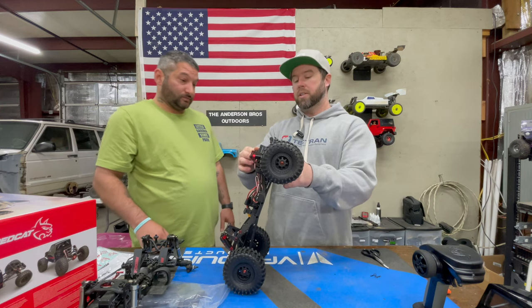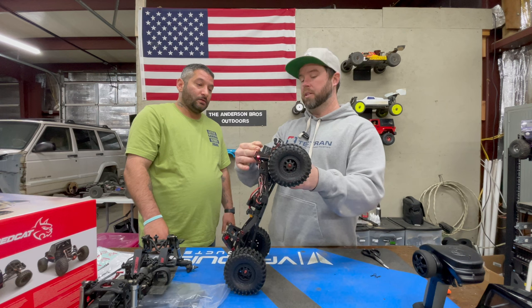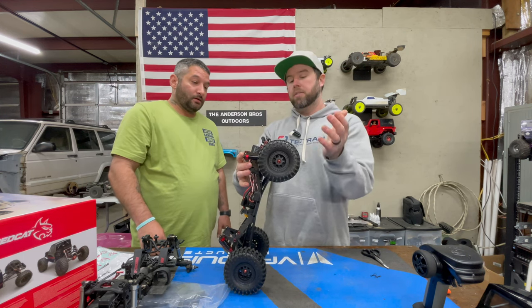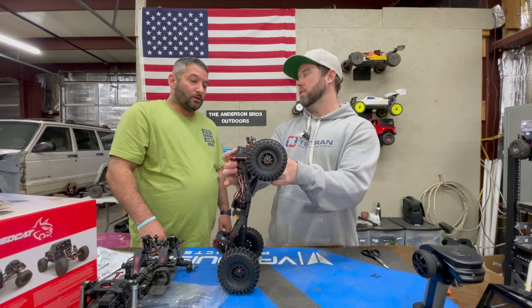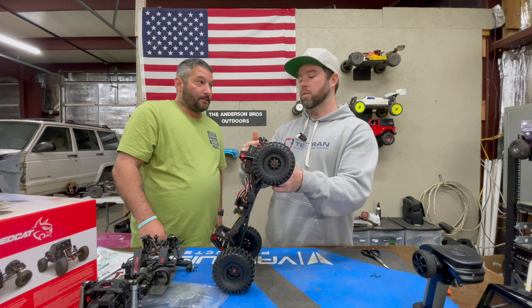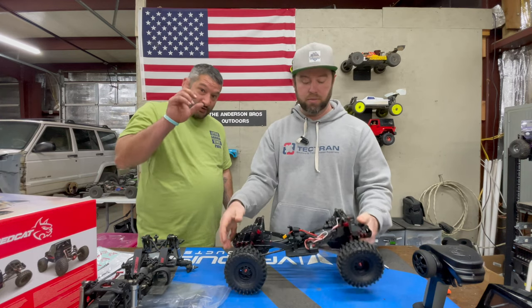The reason for that, I was very curious, is because when you're doing a climb like this, you want the chassis to stay as close to the axle as possible. You want it to be loaded. That's what's called loaded. Okay. And so when you're doing the climb, if the front wheels lose traction for any reason, then they're just going to hang there, and you're going to go from loaded to unloaded. And when you unload, you have the higher possibility of shifting weight, moving your center of gravity, and it will fall back on itself. I do that all the time.